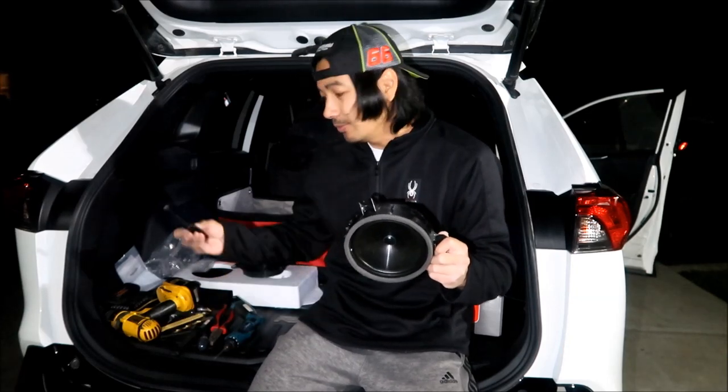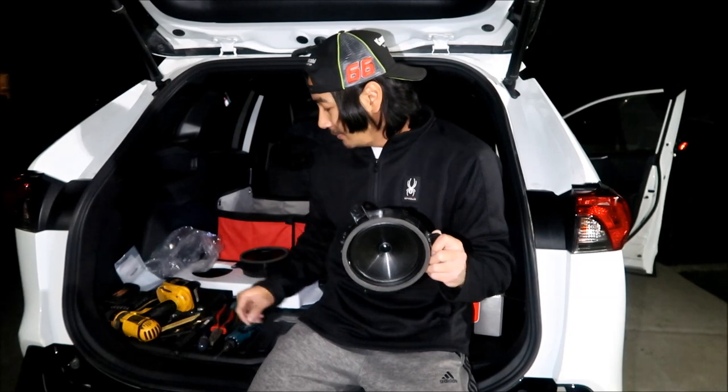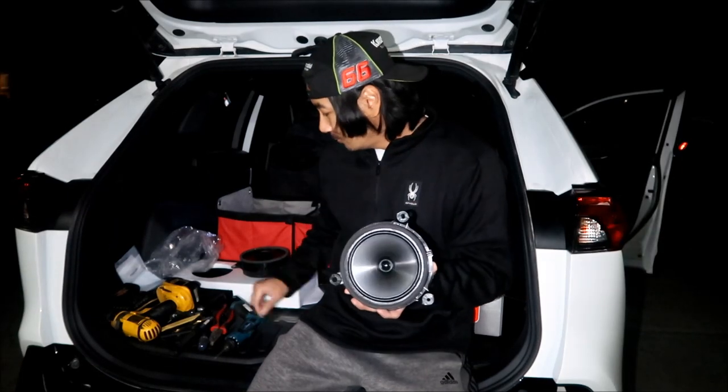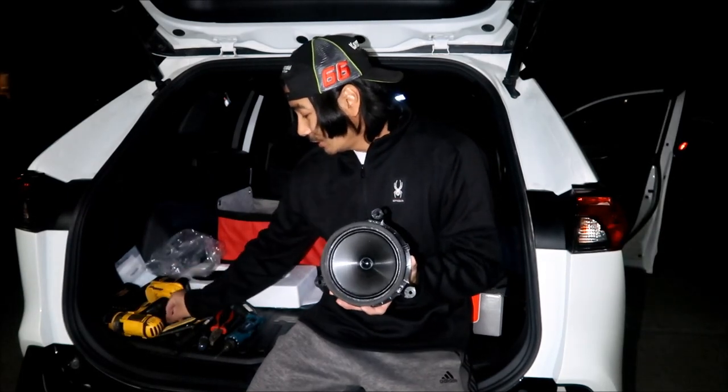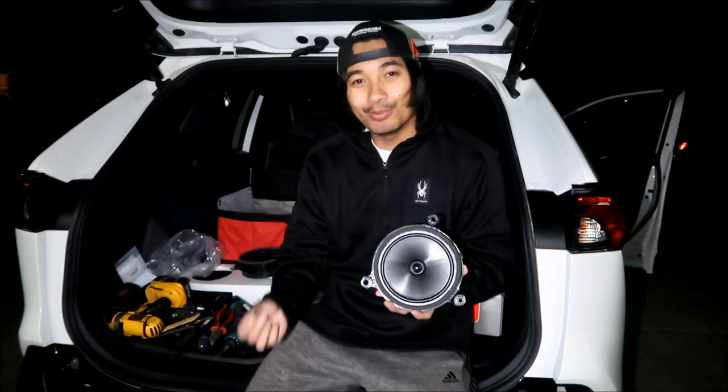And then the little pry bar or a screwdriver helps take the little heads off. And I learned a little trick. The rivet heads that you popped off, you can reuse them. You can use them as washers for the screws that come with the speakers, because the heads are so small on these things. Why can't they make any bigger heads, man? Like, at least make it double the size. If the heads were bigger, we could use them, but if we had a washer, then that'd work also.